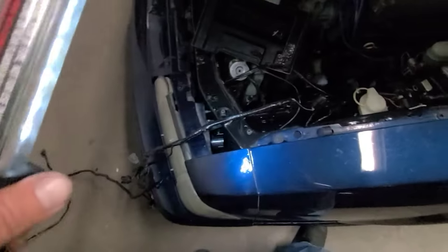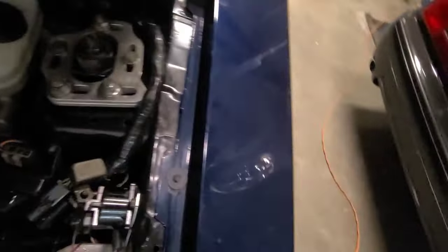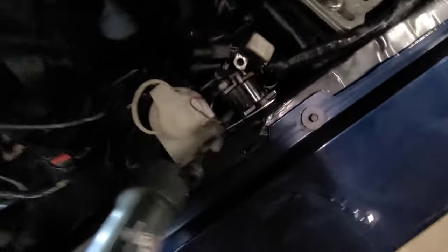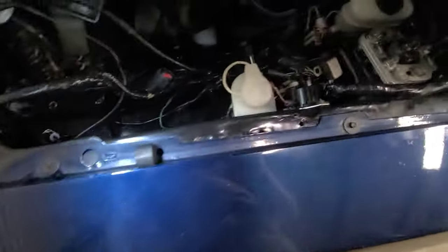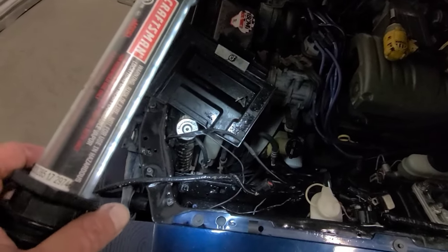Connectors look good, so I think I can save it. We'll find out shortly. Everything unplugged, everything unbolted. The green wire here came off the solenoid. And guys, don't get scared of these solenoids, because everything goes on one plug, except the one that goes to the starter on the other side. It's the one to the right, one to the left, run to your starter, and then, of course, your little wire for your ignition. If you're scared, do like whoever did this wiring harness did, and put tape and write down every single piece. God bless them. I think I remember doing that in the beginning, but not anymore, luckily.